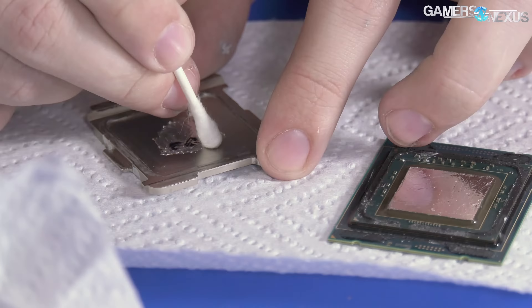This isn't like paste, which will squish out and fill in any gouges or bumps to make up for mistakes. We took a more barbaric approach using a knife, but this requires a lot of patience — slipping or getting too aggressive will very likely result in a dead CPU. As for internal lapping of the IHS, we used grit 600 sandpaper, then 1,200, then 2,000, then 2,000 wet, then 3,000, then 3,000 wet. We ended up with a very polished surface — good enough to see an improvement.